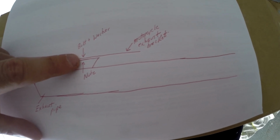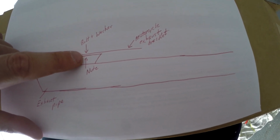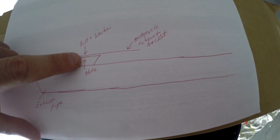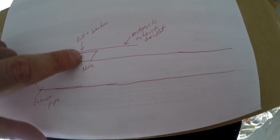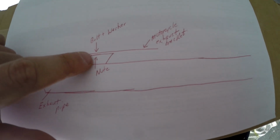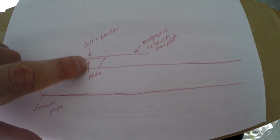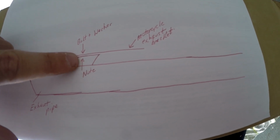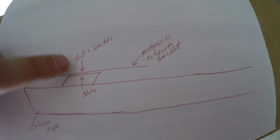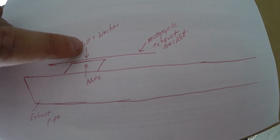Another way that I did, I think is pretty helpful, was I got some super glue and I put a very thin film away from the threads on the nut, just on the underside of the nut, and I basically just stuck it up in here before I affixed it to the bike. Otherwise you'd never get it in the right place. So you pre-stick them basically, align them with the holes, make sure it's nice and secure, press on it for a few minutes, and then you proceed to putting it up against the bracket with this nut temporarily affixed or loosely affixed. I mean, it's super glue on metal, so what's it going to do? At that point it's lined up, and you just put it over the hole and the bolt's already lined up. You can drive it through.